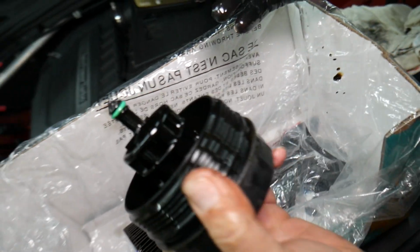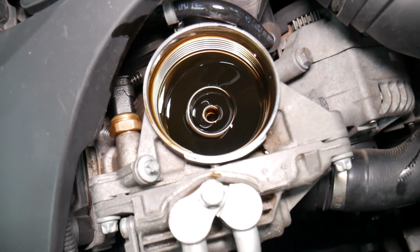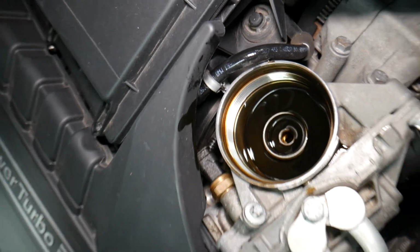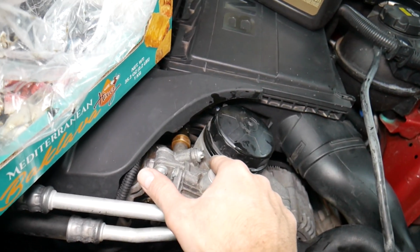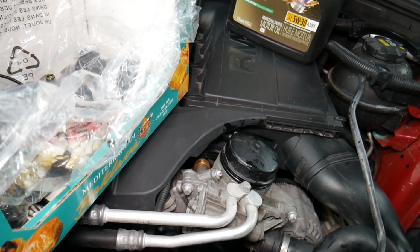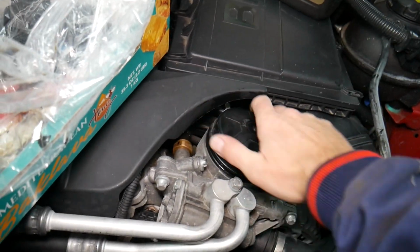Okay, perfect. Apply a little bit of oil on the rings. The filter is a non-directional filter, so just get it and push it in until it locks in place. Here, it's all draining now. Okay, let me make sure everything looks good. Yeah, it looks good, so we can go ahead. Okay, and start it now. And tighten that filter. Now, a common mistake people make: double sealing here, the O-ring, not getting the cap tight. Later you can start leaking oil out of here, the engine can be starving for oil and you can destroy your engine. So we're going to go ahead and tighten it now.